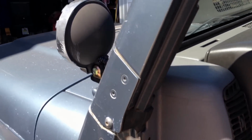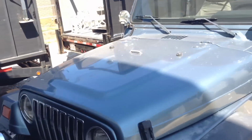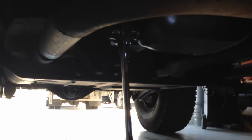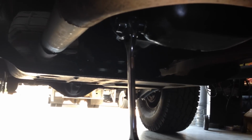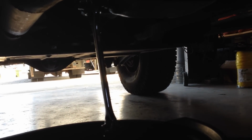So we're gonna drain the oil and the antifreeze and start out with that, and then we'll kind of walk through taking the motor out. So hopefully if you're about to pull your engine out, you know how to change the oil, but just in case, it's a 16 millimeter. You're gonna loosen that guy, drain it into something, let all that come out. I'm gonna leave the oil filter in this one, make it a little bit cleaner.